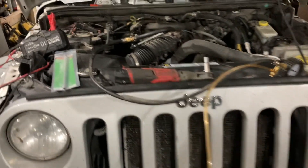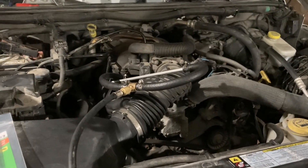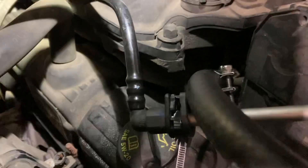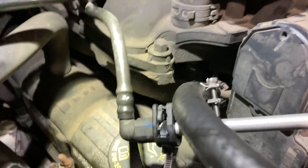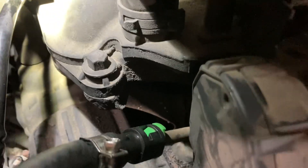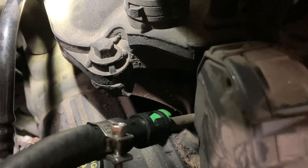On this vehicle, like on a lot of new cars nowadays, there is no Schrader valve to check for fuel pressure. So what you have to do is — that 90 degree elbow right there, that is the factory quick connect fitting. It goes to right where that green clip is, right next to the throttle body, and it connects to that line right there. So that's where you have to disconnect it — it's a plastic clip you have to remove.